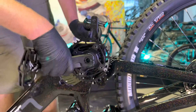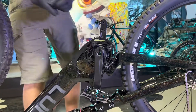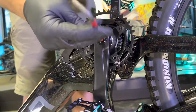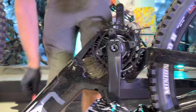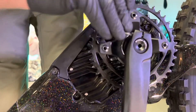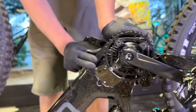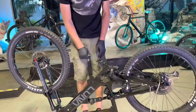Go ahead and throw the crank arm on and we're good to go. Note that it will let you put the crank arms on crooked, so make sure it's perfectly straight before tightening. Use your 6 millimeter to put the axle cap on and your 4 millimeter to tighten the two pinch bolts. That's the removal and reinstall of the M600 drive — this applies to both the X1 and X2, it's the exact same steps.